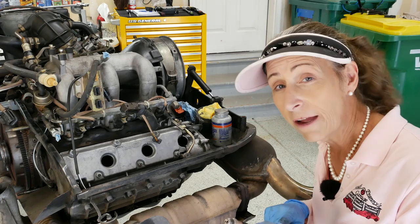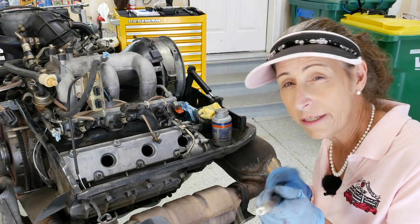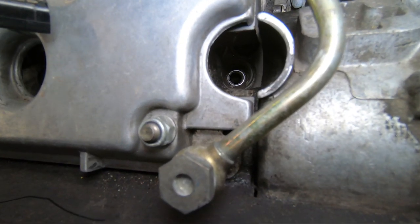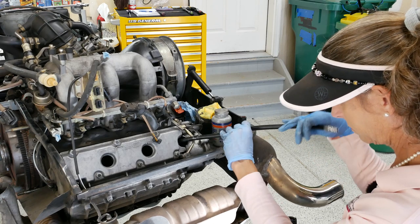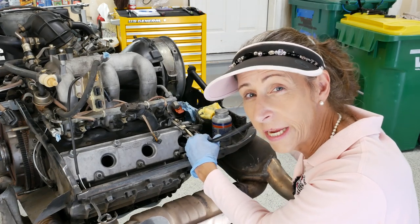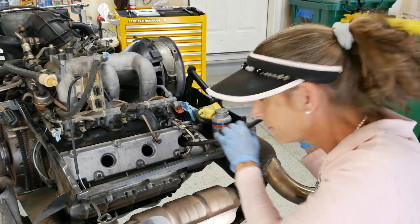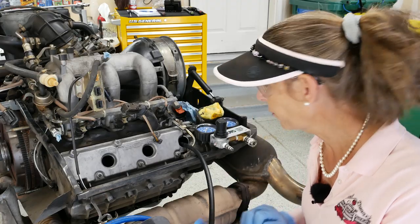This is the tricky bit — we have to feed this thing in and get it to screw into the spark plug hole. Feed it in nice and smooth. Never, ever force these things — the last thing you want to do is cross-thread your spark plug hole. It's feeding in nicely. It doesn't have to be very tight; it has a rubber O-ring at the base so it'll seal perfectly. When you feel the tube turning more than the end, you're done. Anytime you're using compressed air, use safety glasses just in case something goes wrong.